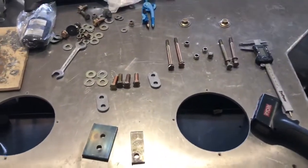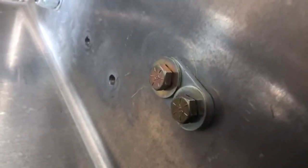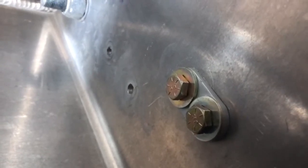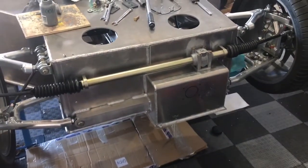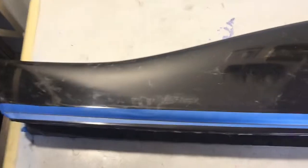The steering rack is back on and torqued. Looking inside the footwell you can see the backing plates - I still used washers so the bolts had enough room to thread into the pillow block, and it prevents gouging up the paint on the backing plates which could cause rust. That steering rack was really a challenge because I had to drill those holes and I put them in the wrong place, but now we move on.